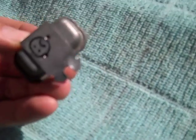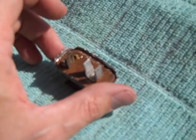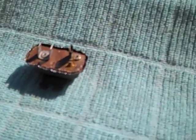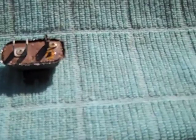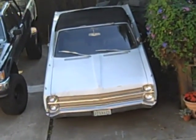So this little guy is underneath, on the back of the instrument cluster, sometimes kind of close to the fuel gauge and the temperature gauge — it brings it down to 5 volts from 12. This one is out of a 67 Plymouth Fury.